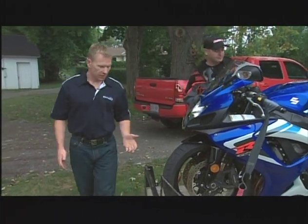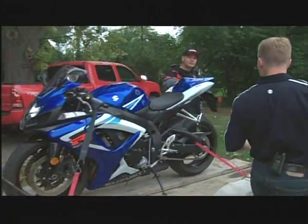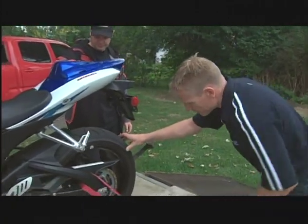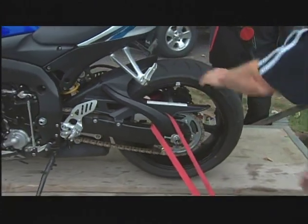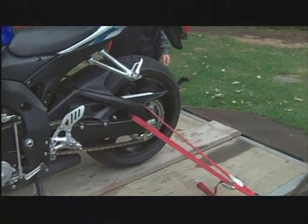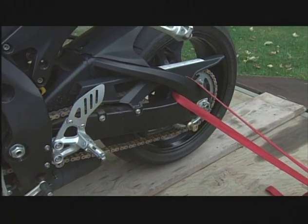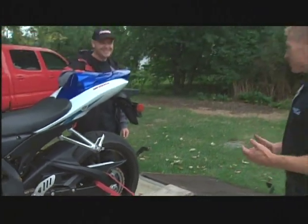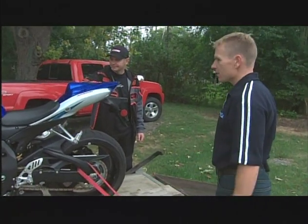From there I go around to the back tire and push it — make sure there's air in it. The brakes back here, all the bolts are tight, no fluid, looks good. Now while I'm here, I take a quick peek at the chain because that's a very important part. It's often greasy so you don't want to touch it with your hands — there's nothing wrong with using your foot on it. According to your manual, about an inch of slack halfway between the sprockets is good.